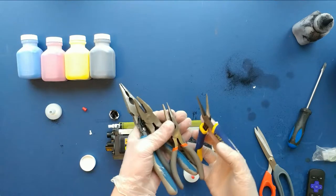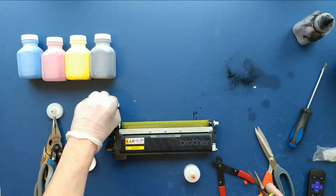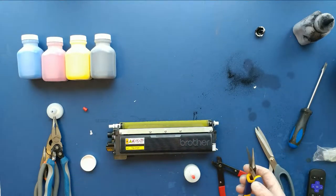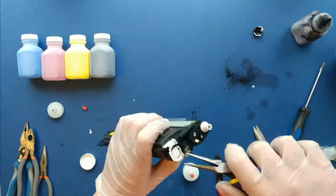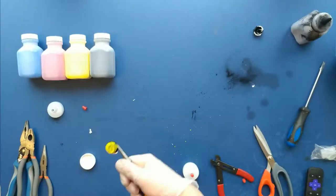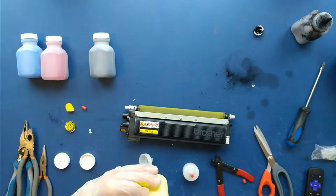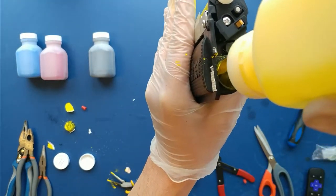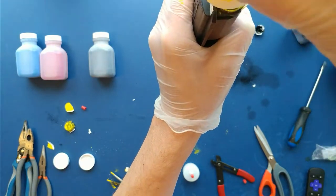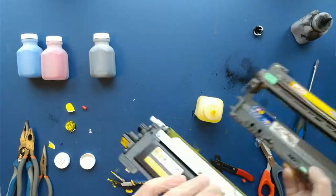I got four different kinds of pliers here to try out. The thing with getting this rubber piece out is you need leverage — you need some sort of angle, which is why I broke the piece the first time. I found a pair of needle nose pliers to use. It took me a while to figure out that the best way is to jam it in between the seal and the edge of the opening. Then I used the new wider-cut toner nozzle and it seemed to work pretty fast. I put the piece back in and that was it.